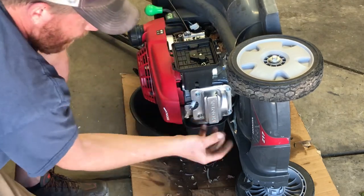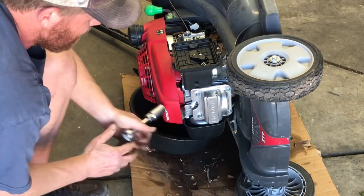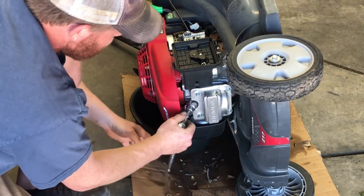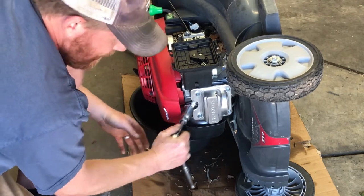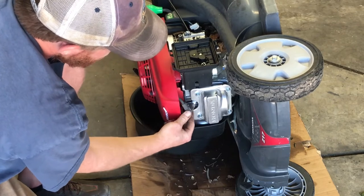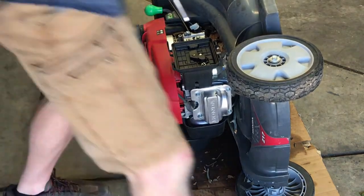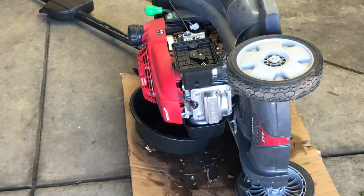But you saw I did that all by hand. I put the spark plug all the way in and it's tightened by hand. Then you put your socket wrench on there and just barely snug it. Don't use the socket to start it because if you cross-thread the threads, no bueno. You'll ruin the head.